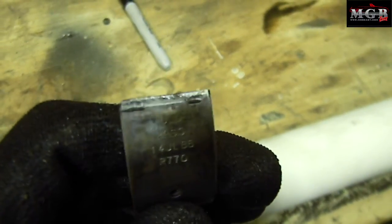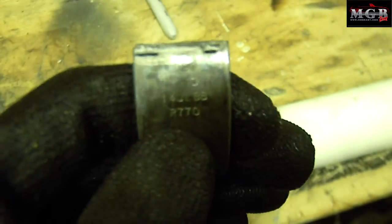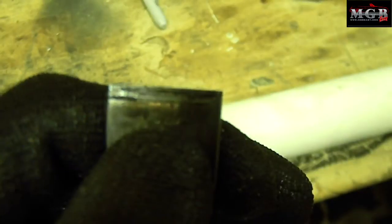If you want to know if your crank can be machined again — because we need to do that to ours — there are some numbers on your bearings. The very top number on ours says zero-two-zero, which means our crankshaft has probably been machined once already, and we can go up to 40. So we could machine it two more times without having to replace the crankshaft. Since we need to machine this, we will need to increase the size — the thickness — of the bearings to 30.